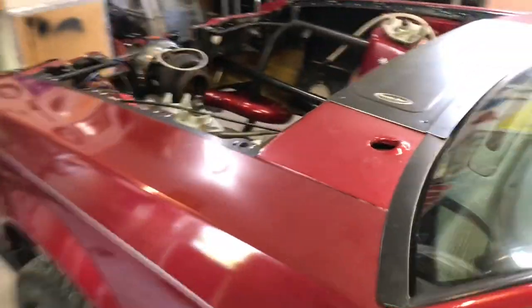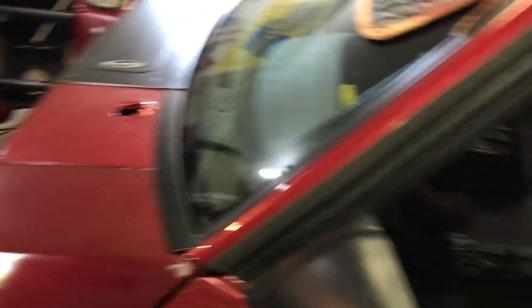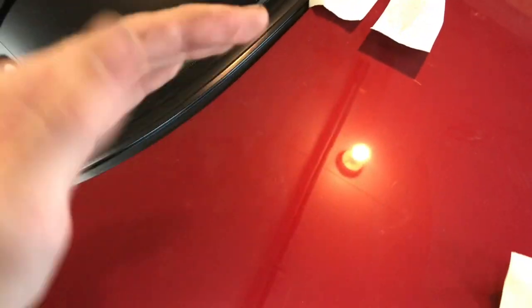We were done for the night when we saw that, because we didn't have any push-lock hose. I had routed the boost controller incorrectly. We took it home, changed all that, and went back out Saturday thinking we'd have no more boost fluctuation.